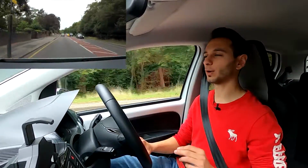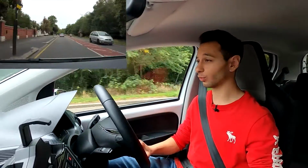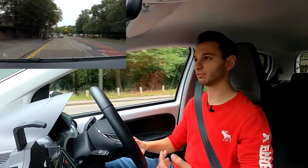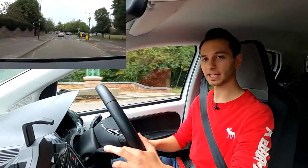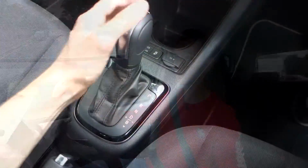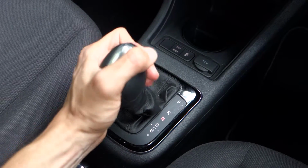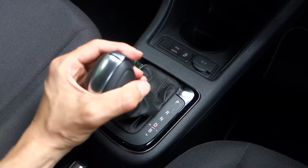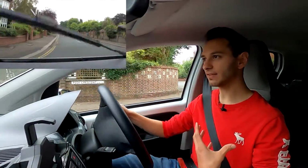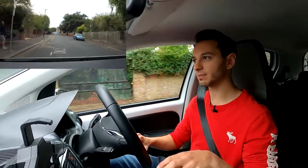The only thing I'm not a fan of, however, is its regenerative braking. I'm not talking about its operation, because in Regen level 4, or the 3 other levels that you can choose from, I have no issues when it comes to a one pedal approach. It's actually pretty nice to recoup as much energy as you can back into the battery pack. What I don't like is accessing it. Each time you switch on the car, you need to go on the gear lever and either shift to the left or right to access the 3 different level modes, so level 1, 2 or 3, and if you want level 4, you'll have to shift down on the gear lever. I find this a little bit tedious, and as I've noted in other VW vehicles, it doesn't save the last mode that you drove in, and instead means that you have to set it each time you step inside the car.